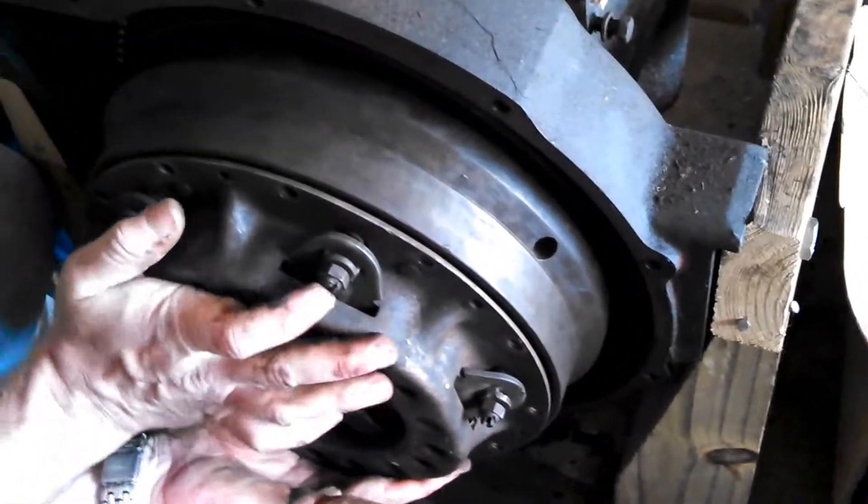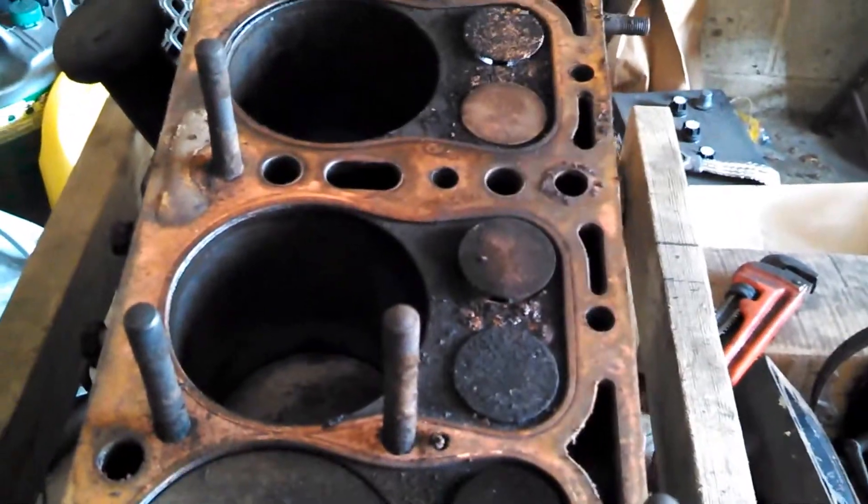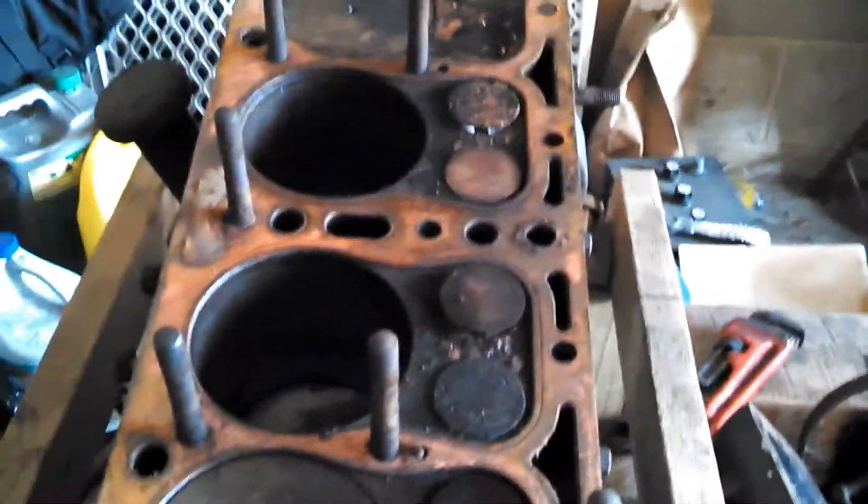You've got all these big honking springs inside here holding it together. So when this is assembled it's kind of floating like this - I just took it off this morning. It's on here like this and this whole thing spins together as one piece. There are bolts that go in right here and hold this all together - here are the bolt holes. When you press the clutch, it pulls this away from this thing, so now there's no pressure on it and this thing can just float around and spin at a different speed. That's how you disengage.